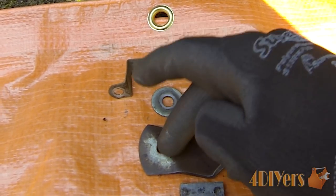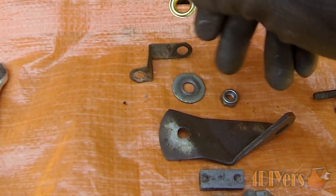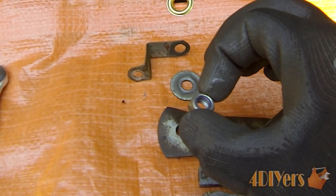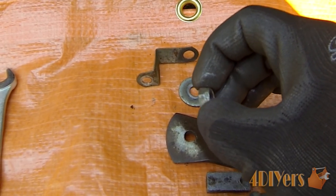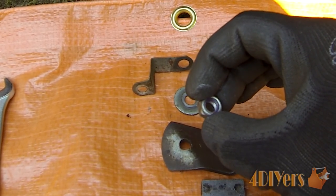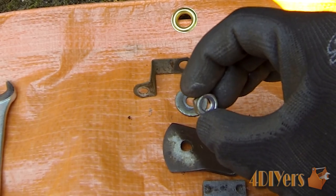The washer is intended so that everything moves freely in the assembly. We do have the metal retaining tab and a lock nut. I do recommend having a locking nut to hold everything in proper adjustment, because a lawn tractor vibrates quite a bit and travels over rough terrain — this can loosen up and put your brakes out of adjustment.